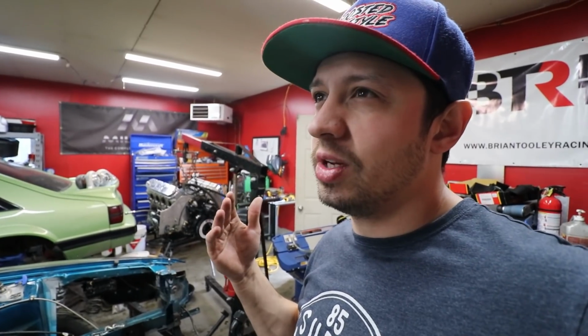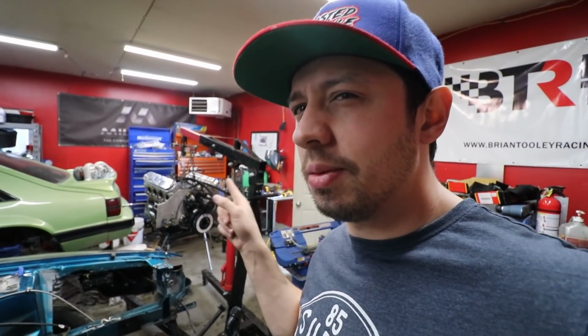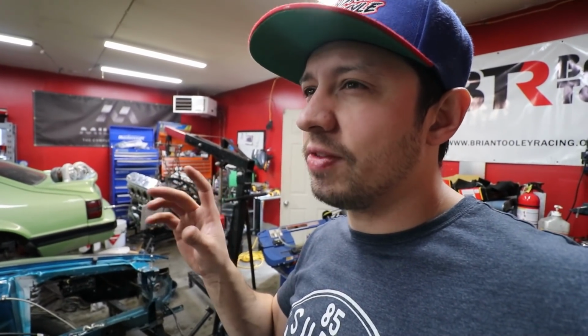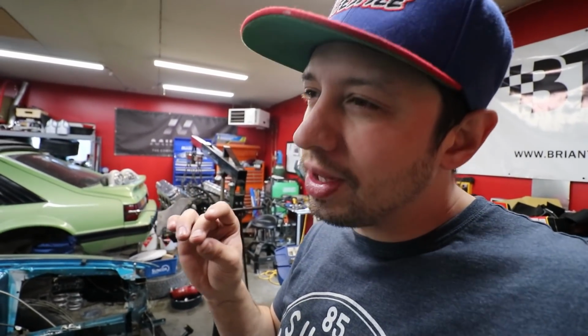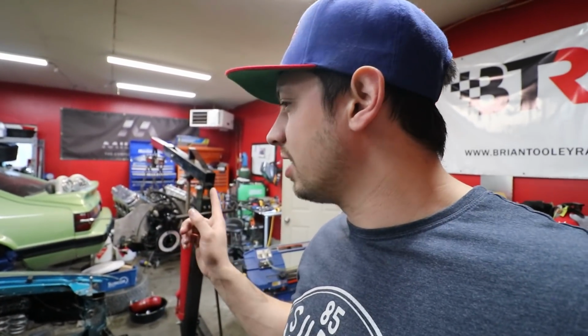Actually, now that you get into it, after adding all that stuff, you might be able to get yourself into a Coyote, like fairly to the same price. But you have to change the oil pump gears and the sprockets on a Coyote in order to maximize it. And then the tuning, you know what? I'm still saying that the Coyote is probably about double the price of an LS engine wise, and then the rest of the components are probably the same price.